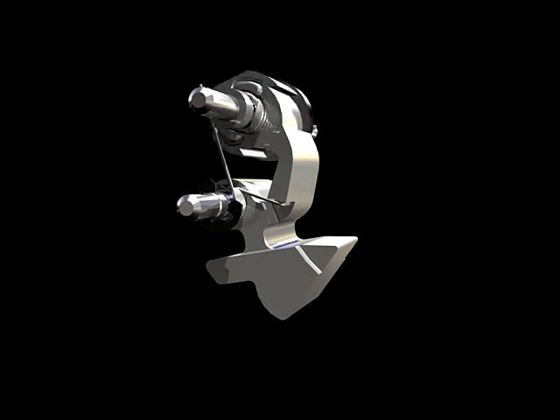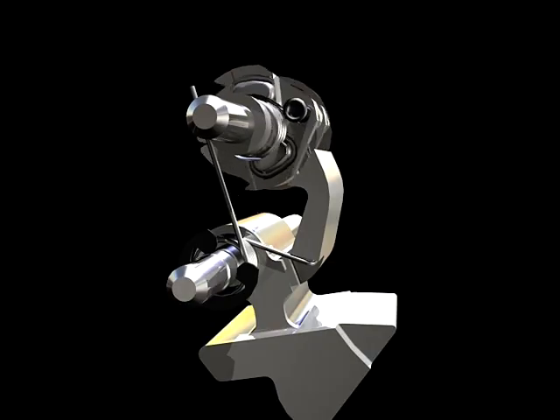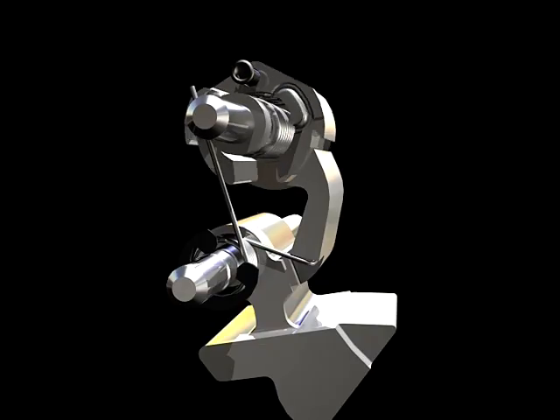The mechanism is made up of two fly weights that are spring loaded toward the center of the shaft. The shaft rotates whenever there is a difference in speed between the wheels. When the differential speed reaches approximately 100 RPMs, there is enough centrifugal force on the fly weights to overcome the centering spring. The fly weights move outward to catch the paw of the lockout mechanism.